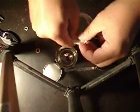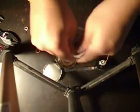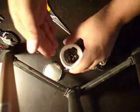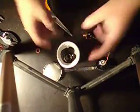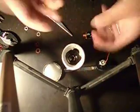Anyway, the gasket is really one of the most important parts of building your own mics. And it's probably a big reason why people think some mic that they made themselves doesn't sound as good. Because what you need to do is separate the part of the mic element that gets sound waves hit onto it from the back, to set up a pressure differential so you can really drive that element. You need to keep the back pressure area clear. You don't want any sound waves leaking around the edges of the mic, because then you're going to get reverberation inside this chamber. The waves are going to bounce off the back, come back and hit the inside of the element. You're going to get a thin tone out of it.